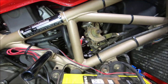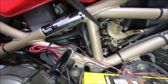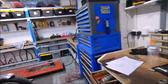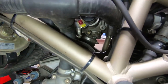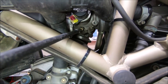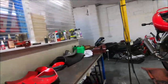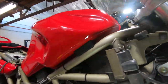Being a two-valve, the air bleeds — I can make it all work. There's one air bleed there — that's the horizontal air bleed — and the vertical air bleed is around the other side underneath the throttle bodies. They're wound all the way in at the moment; they were about a turn out I think. And they're wound all the way in so I can adjust the running balance, or the sync between the two cylinders.